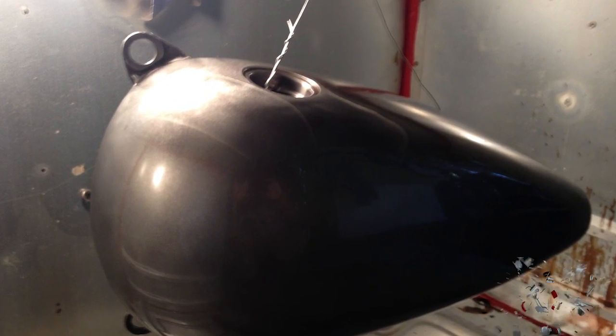So, I took another tank and after sanding it down to metal, I gave it a nice coat of clear powder. The shiny metal look will replace the silver leaf look I had in mind. It's quite different, but still a very nice alternative. Another advantage of using a powder-based coat for the tank is that it will make the sheet metal 100% rust-proof, whereas regular airbrush clear coats, at least the type sold here in Europe, will not keep the metal from rusting. This might be useful to some of the folks in California where environmental regulations are just as strict.